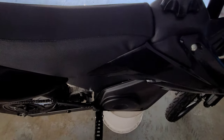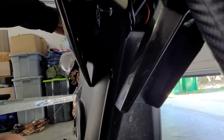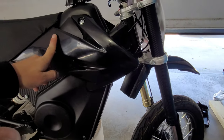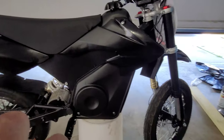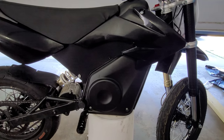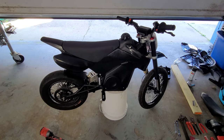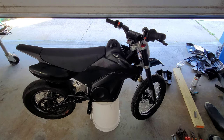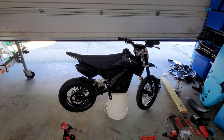It did give me a lot of room underneath to mount the controller. I made these side panels so you can't actually see any of that. It actually works as a functioning shroud — when you're riding it'll scoop up air and push it into the controller, keeping it nice and cool. I have so much room in here for a bigger battery. Shout out ElectroCo — I actually got a 72 volt 24 amp hour coming from them. That specifically states on their website it does not fit in here, but since I moved the controller I'm sure it's going to fit. So don't go buying one if you still have the stock bike, because it's not going to fit.